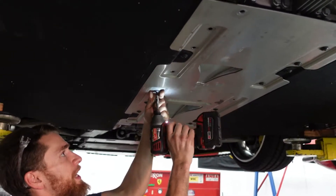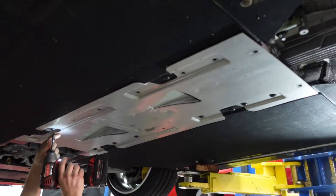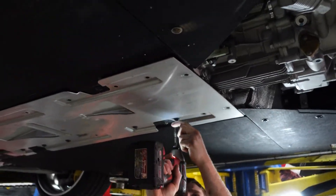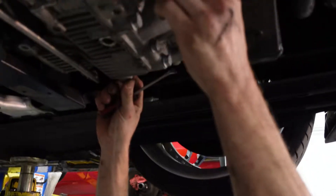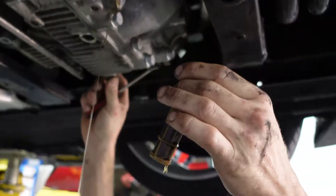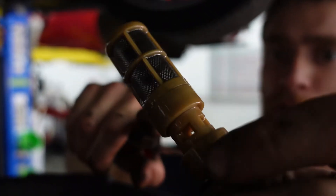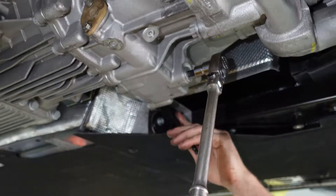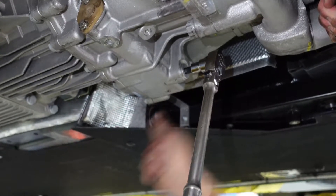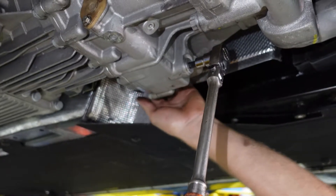For the transmission drain, we have to take the center pan out — it's the metal one. And we'll be able to access the gear distribution. This is the rear diff filter — having it out. Always have to clean it pretty good. Make sure we have no dirt and no contamination going into the new fluid. Transmission is the same thing — make sure that filler will come loose. Otherwise, we never know if we'll be able to fill.